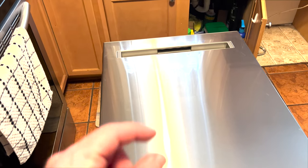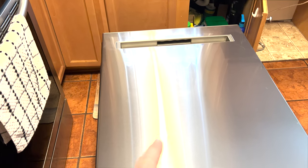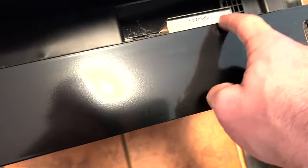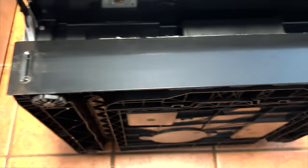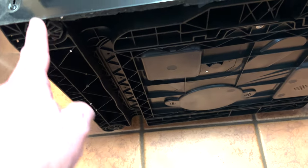Be really gentle when you're taking the twist ties off. The middle rack was tied to a water supply line in the back, and if you pull that shelf too hard, you'll pull on that water line and probably break it, so look really closely for the wires. Next, take the kick plate off the front with two screws to access the electrical. You'll also see the fill supply line there. You'll want to adjust your leveling feet while you have it laid out, because once you slide it in you won't be able to reach the back ones. Preset the back ones to the correct height, then adjust the front ones after sliding it in.